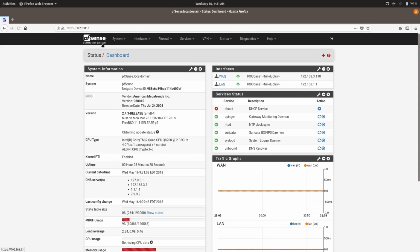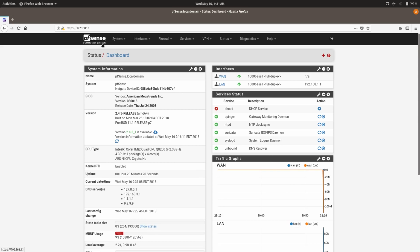And I had mentioned setting up, a lot of people go, okay, I want to separate my computer versus the rest of the insecure devices and things that get plugged in. And we're not doing this with VLANs. Like I said, for this demonstration, we're going to set up another network port, and we're going to expect that you have a different switch that plugs into than the one that your LAN's plugged into. So this is a 2-switch setup. So we're going to go over here.